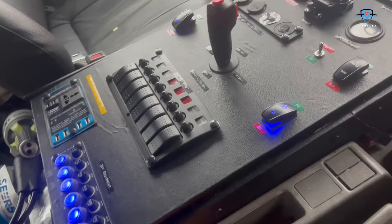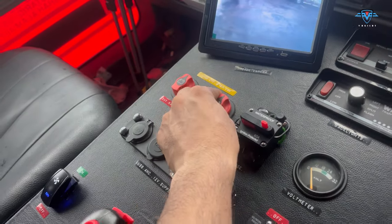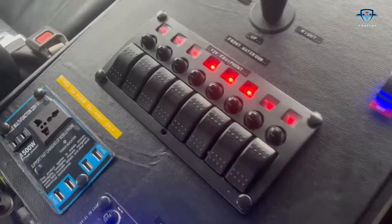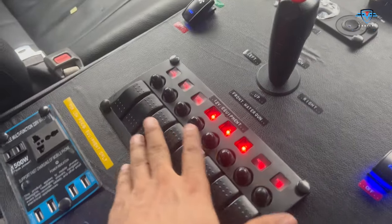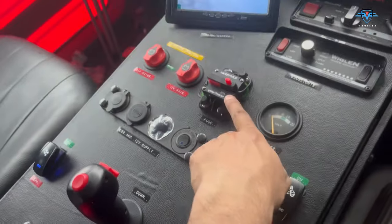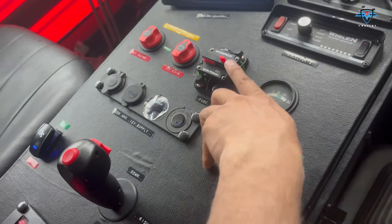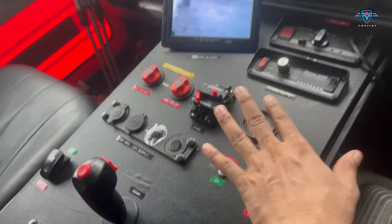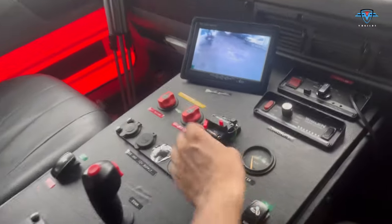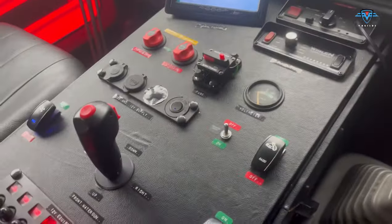Okay, next. This switch is for 12 volts. When you turn this one on, you see this panel lights up. This is for everything which is 12 volts. I'll go over these one by one. Before that, this right here is the fuse. Let's say the current is too high, this fuse will pop, and you can also manually pop it. You just press this button. You see the fuse pop, everything stopped, nothing is working now. You pop it back in and everything is back alive. The fan is on. All the things are working now.